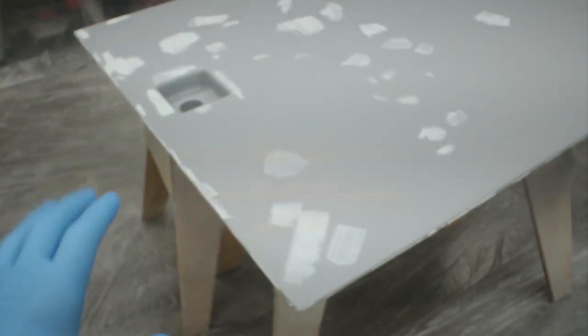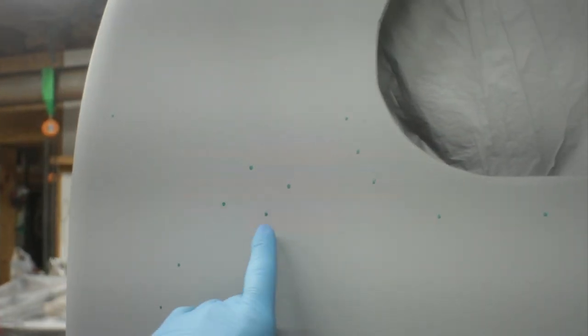It's the next morning, and I figured I'd give you an overview. I've gone ahead and spot glazed our pinholes in the door. I've gone through this morning and put a Sharpie mark next to all these tiny little imperfections that I want to fix. This just helps you find them at a quick glance when you've got filler trying to kick on you. They're hard to even see when it's an 1/8-inch Sharpie mark.